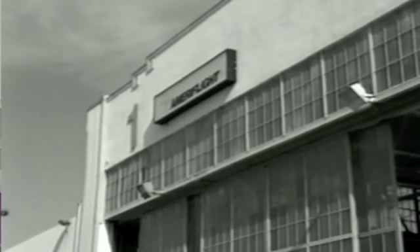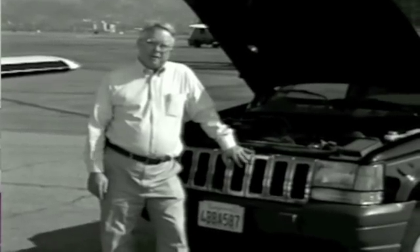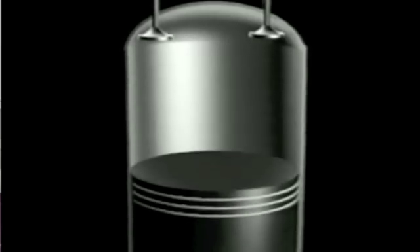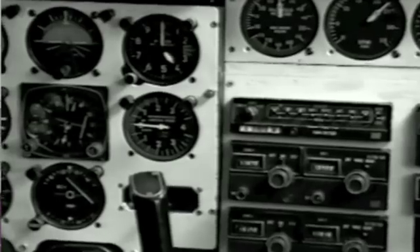Let's talk about the steps you'll want to take prior to landing. At Ameriflight, we've developed a stage cooling program designed to reduce the engine stress associated with power reductions. Your aircraft is equipped with an air-cooled engine that's pulling a tremendous amount of power. Unlike the liquid-cooled engine in your car, your air-cooled engine reacts very differently to sudden power reductions. Abruptly reducing power causes the various engine parts to cool off and contract. Since these parts are made of different kinds of metal, they'll contract at different rates and may crack under the stress. Regulating power reductions is important in naturally aspirated engines, but becomes crucial with the turbocharged engine. The concept behind Ameriflight's stage cooling program is to reduce power in small increments in order to give the engine a chance to catch up.